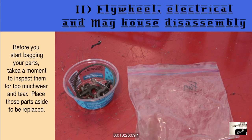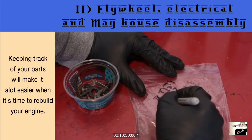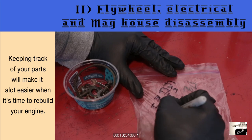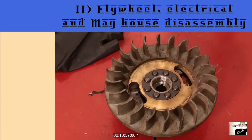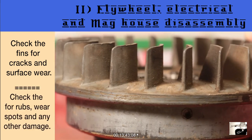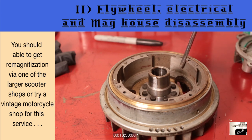Lastly, we want to organize and inspect our parts. Now that we have a small cup or bowl filled with bolts, screws, nuts, and other small parts, transfer them into a plastic ziplock baggie marked with a permanent pen to identify what's in the bag. Next up, we'll want to inspect the flywheel. Pick it up and look all around for wear spots, cracks, or other forms of damage. Also, check and see that all the magnets have about the same amount of pull to them. If not, it might be time to replace those magnets or send your flywheel out for new magnetization.